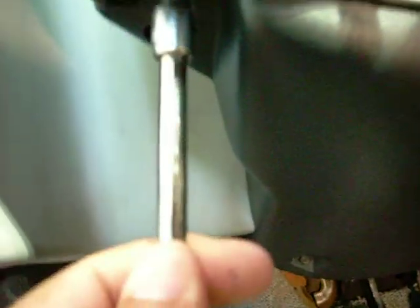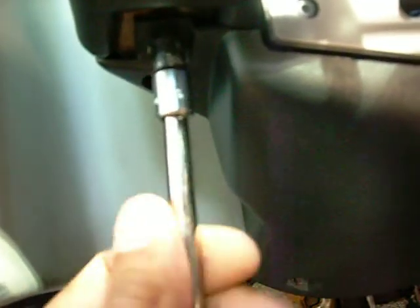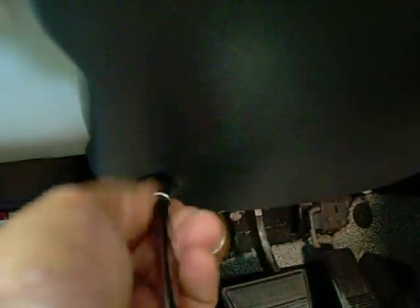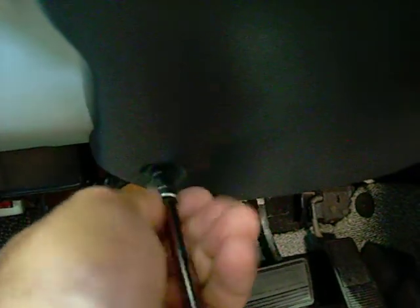What I'm going to do now is take off some of the plastic pieces — you have to take off the bottom one here. There's a screw here, one down there, and one up here, and the same thing on the other side. I have a 7mm socket, which I'll use to take off number one. These should not be too tight — they don't need to be 10 pounds. This is just a cover piece, a trim piece. It doesn't need to be re-torqued.